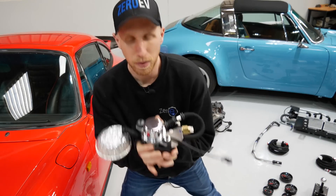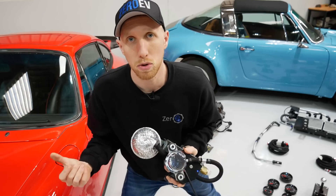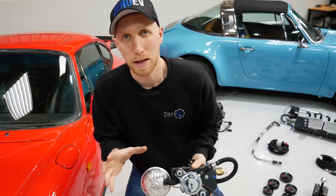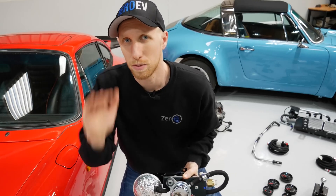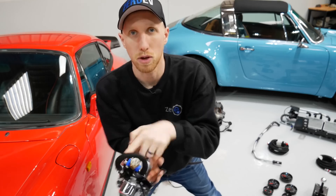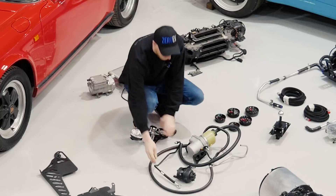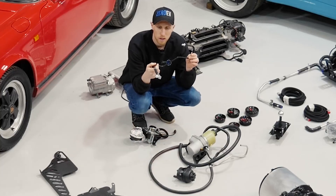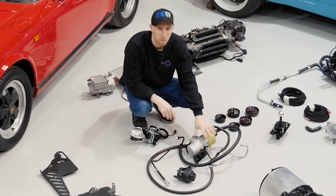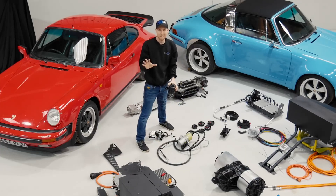This is our brake vacuum system. It replaces the original vacuum from the Porsche motor, which would have put a vacuum to your brake servo. It's a small vacuum pump and a reservoir — it gets up to pressure and then maintains that pressure, so it doesn't come on all the time. Every time you press the brake it keeps it nice and quiet. It plugs into your original IO loom that we've supplied, and there's a little output which goes to your servo. You've also got the same with your power steering for the 964s. We have produced power steering lines that screw onto all the original lines — you don't have to make up any custom lines. You have an electric power steering pump and a reservoir. The reservoir positions itself on the front strut brace — easy to top up and maintain.